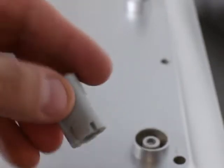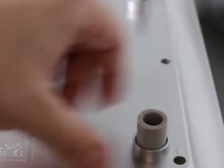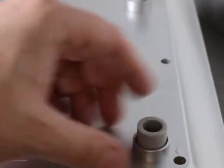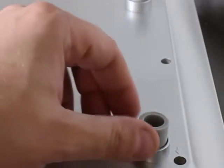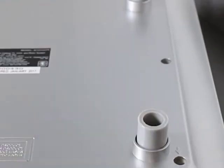Included are four mounting spacers with grooves in them. These grooves allow for a quarter-inch offset from the bottom position of the mount. Using the included hardware, lower the screws through the screw holes of the cabinet, past the spacer, and into the unit where it will thread. Have someone help you hold the unit underneath the cabinet as you thread these screws. Do not use power tools — use a handheld screwdriver to prevent the screws from cross-threading or stripping.